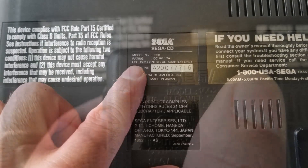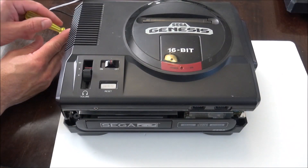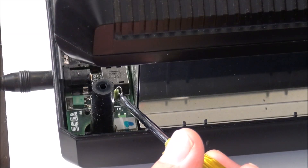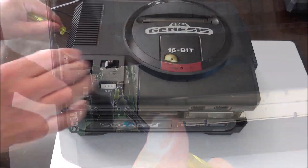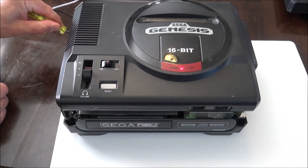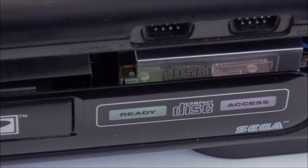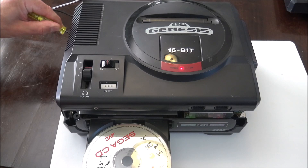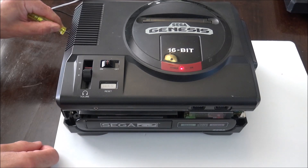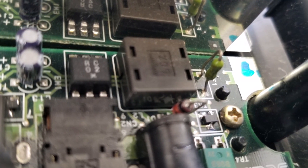Now plug in the power, and make sure to use the correct power adapter — a lot of times that's why these fuses get blown, from using the wrong adapter. With power plugged in to both the Genesis and the Sega CD, carefully bridge those two points on the fuse together, then turn the power on on the Sega Genesis and test to see if the Sega CD turns on. It looks like I got lucky because my Sega CD is now alive. Pressing reset, the tray pops out — and I got a free game with this Sega CD, Star Wars Rebel Assault. So I've now confirmed that the fuse is the issue.